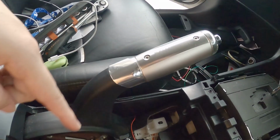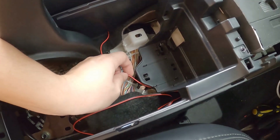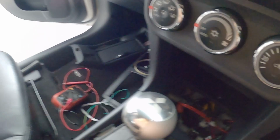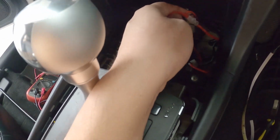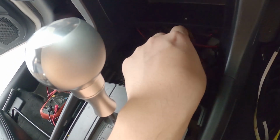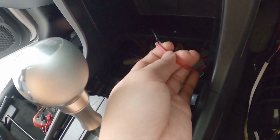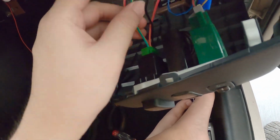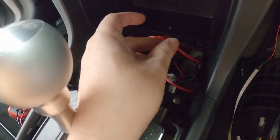So I have two lights under the seats, which come up to the center console over here. Alright, then both the lines will come to the middle here. Same thing with the lights over here on the passenger, and on the driver side it comes back down to here. So you see four lines here joining to a positive, and the positive line, the power line, is from the 12 volt coming up here into the switch. Then from the switch, one more line goes back over here to where the lights' positive is supposed to be.